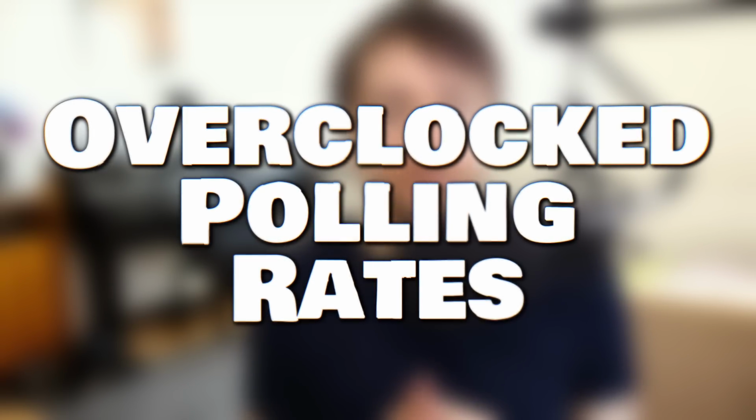Overclocking polling rates is something I first showed with the DualShock 4 because of the significant input lag advantage there. Again, that is coming in the next section, but can we improve the amount of updates of the controllers? Unsurprisingly, the answer for the Xbox controllers is no. They give 124 updates even with a 1000 Hz polling rate.